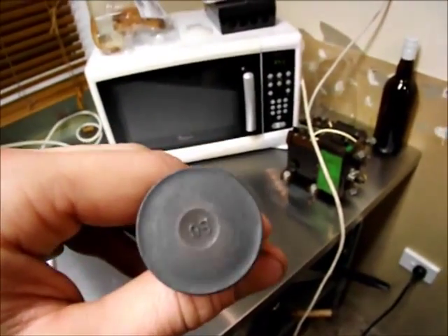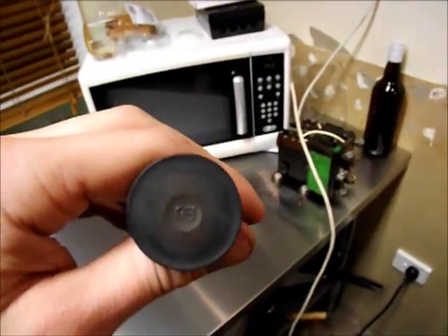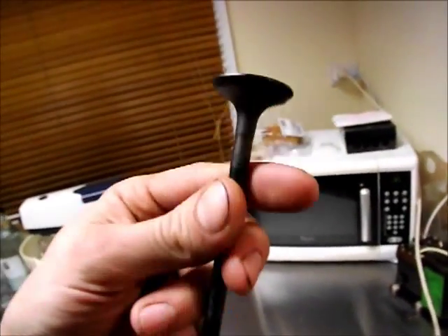You can just see clearance between the bench and the valve face. The head of the valve — well it should be flat, it's not flat anymore. It's sort of started to be pulled into the valve seat because this valve's actually gotten hot enough to be red hot. I know this because the valve stem is blue. If you look at the back of the valve, there's no real carbon deposits. If you see an exhaust valve that's really clean like this with no carbon at all, that means the carbon got burnt out of it and sent down the exhaust pipe.